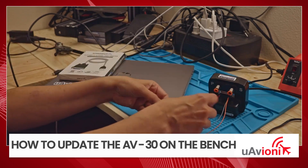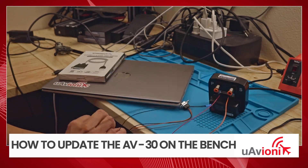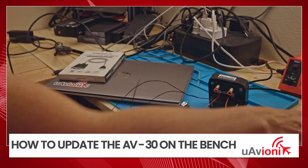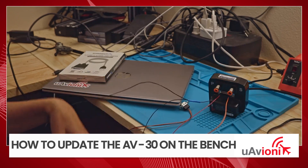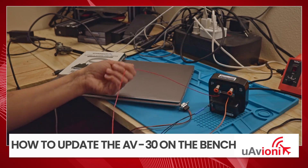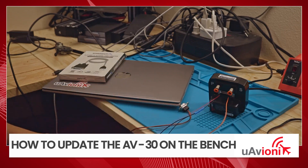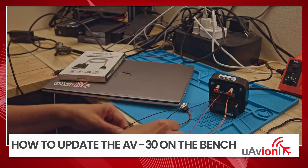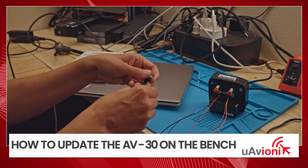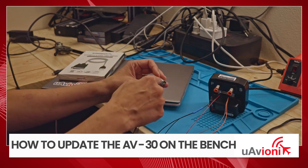On my ground wire, I paralleled that. One wire is going to go to my power supply over here. Make sure that they're not going to touch each other because that could cause some problems. We have the ground going to both — one's going to the power supply, the other one is going to the 9-pin.